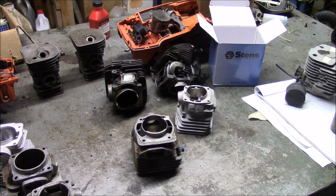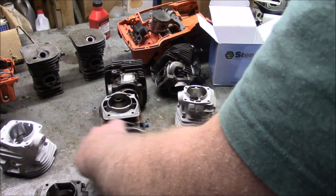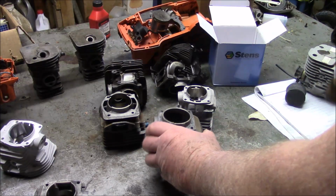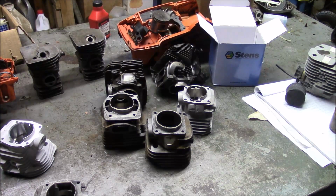A characteristic of a quad port saw is it's typically going to be a little more fuel efficient, all things being equal, and it might make more horsepower. It's possible, but just basically a more efficient design, just because the engineer has more controls. That's not to say that the older style cylinder that has the two ports, one each side, isn't a strong saw. I mean, Stihl made those darn things right up until a few years ago with the MS660, and some of their other models had that same configuration.